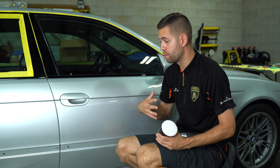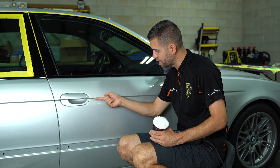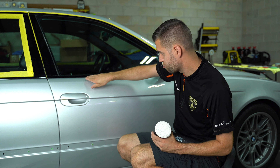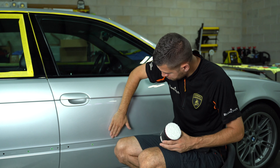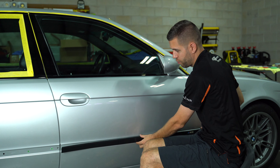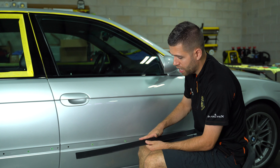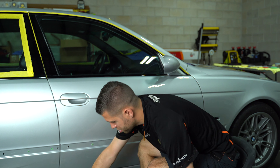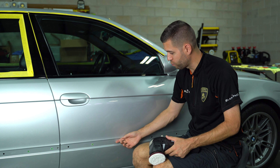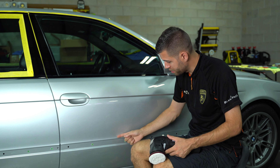What can sometimes be the more time-consuming part is all the edge work — where defects are kind of getting loaded up right on the edge, all around the door handle, the ledge right at the top of the door. Because originally there was a plastic trim piece right here on the door. In a normal case, we would mask this off with tape and come in with, let's say, a three inch polisher right up to that point. And inevitably a little bit of polishing residue or tape residue — which can throw in another variable — might get loaded up in that edge.